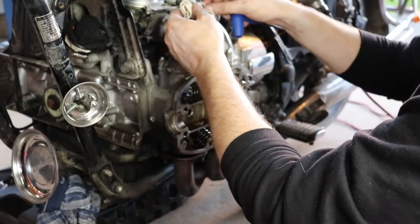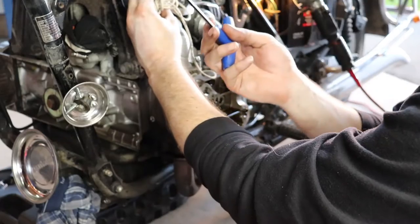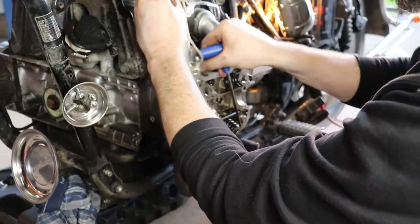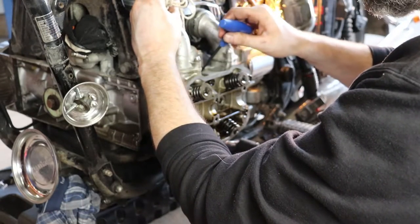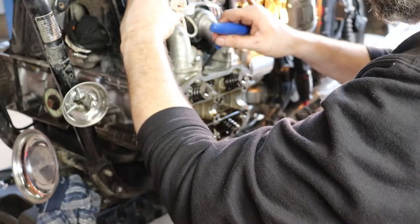I just want to bring you guys back briefly while I'm putting this rope in. This is a game of patience. I'm using an Allen key, long. I'm just folding this down every once in a while. Then I can poke in at the fold and push that and whatever else is down in the spark plug area on down into the cylinder.